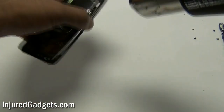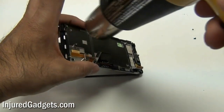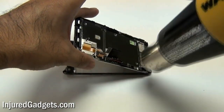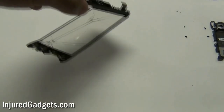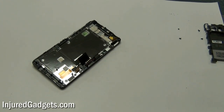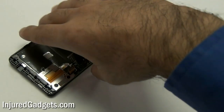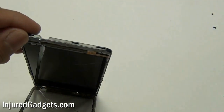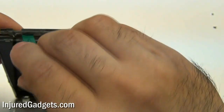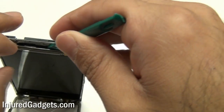You don't want to leave the heat on there too long — you don't want to burn your LCD if it's still working fine. Note that we do sell the touchscreen glass digitizer and LCD assemblies together, so you can choose to replace both. We recommend it for do-it-yourselfers, because with the full assembly you won't need to apply new adhesive or worry about breaking your LCD. It makes the repair a lot easier. However, the touchscreen glass alone is an option if you want to save money — it will be about 30 to 50 dollars less.